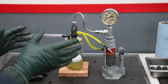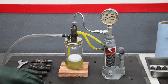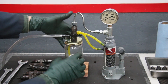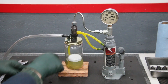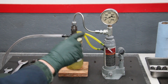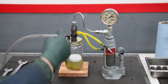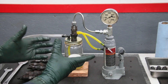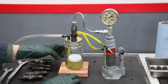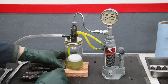Here it is — version three of our bench mount pressure tester. I've eliminated the extra bottle; everything is now one bottle with no separate reservoir tank attached to the pressure tester. We use a pickup and a very fine filter at the bottom of the jar, sucking fuel out and as I'm testing it sprays through the fuel injector and back into the bottle, so the fuel just rotates through. This eliminates filling and emptying during the whole testing process, and the fine filter always protects the pump and injectors from contamination.